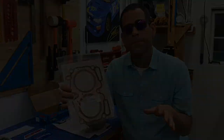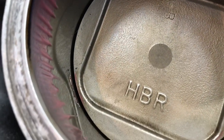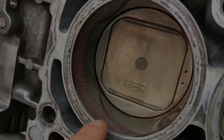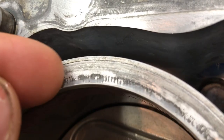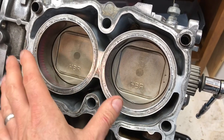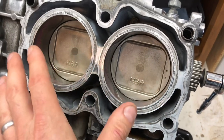I've got these pistons really clean — removed all the carbon using a brass wire brush and some carb cleaner. You'll also notice there's assembly lube on the inside of the cylinder walls; always add a little assembly lube or 30-weight oil when reassembling a short block that's been sitting. For the head gasket mating surface, a good home test is to run your fingernail over it — if you don't feel any ridges, it's smooth enough. You can also use a straight edge and feeler gauge, running it in three directions across the block to verify it's totally flat and true.